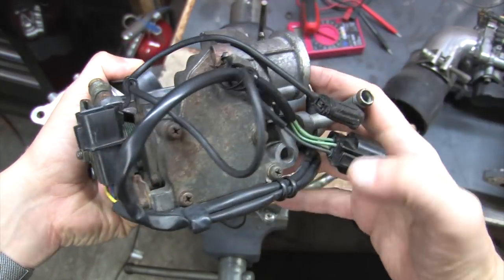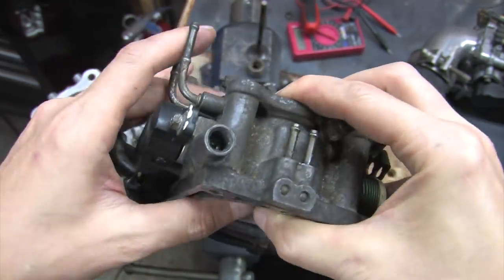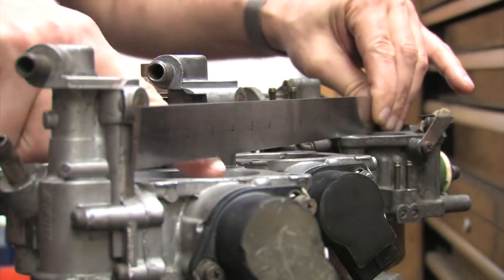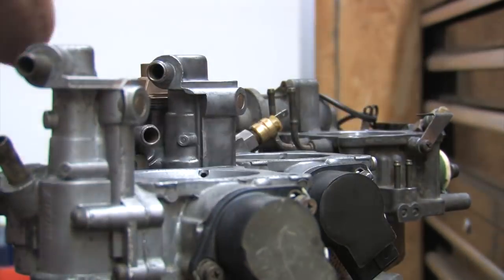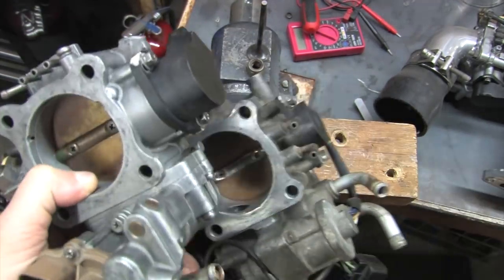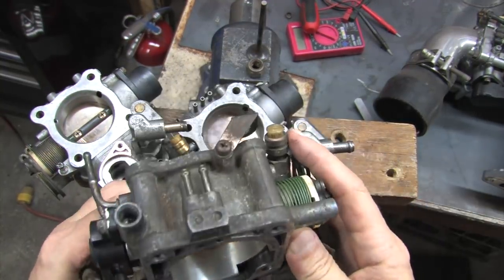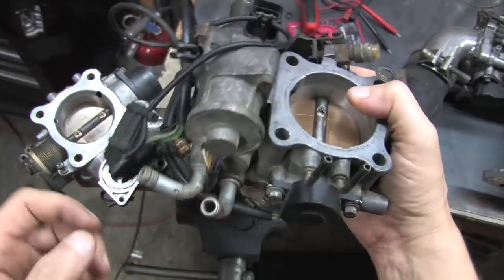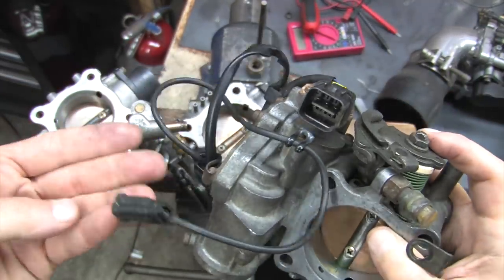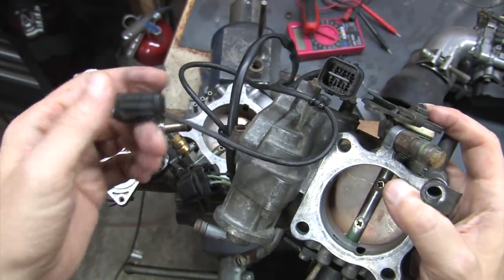It comes with a mixed bag of problems and benefits, and none of them are performance related because it's the same exact size hole. The problems only start when the studs in your intake manifold will need to be removed and replaced, and the TPS sensor doesn't fit behind the fuel rail. It needs different studs and bolts, a different fuel rail, different throttle body ground bracket, different gaskets, different coolant hoses because they won't fit at all, not even close, different electrical connectors on the factory harness for the throttle position sensor, ISC motor, and the idle switch.